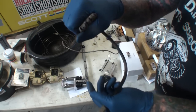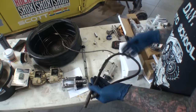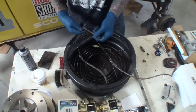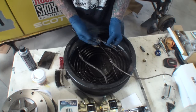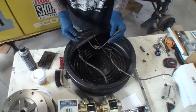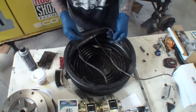I don't know how he didn't blow the brakes out. You can see right here — look at that. Why would you put a rubber one on one side and a braided one on the other side? That is not a good situation. And this is the action they had on their car, which is slim — look how greasy and slimy this is. This thing had to have been leaking at some point. But here's our upper brake line which we will probably have to make new, since the new master cylinders are designed a little bit differently.